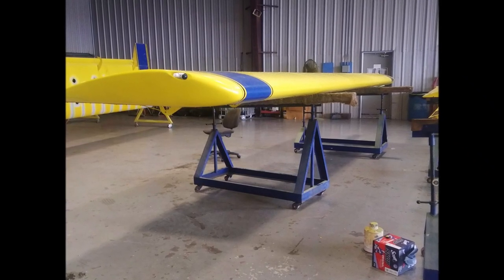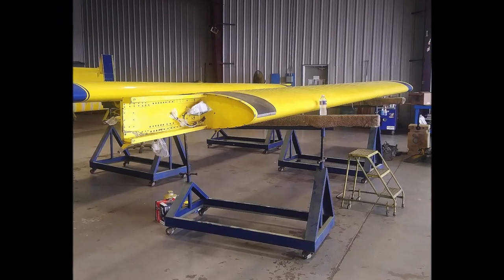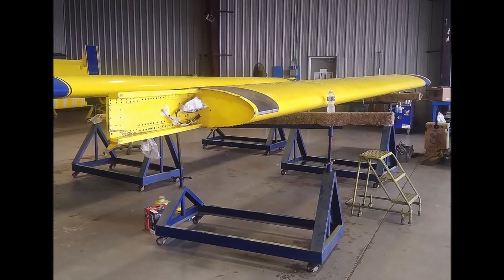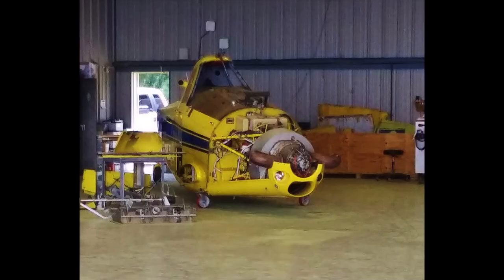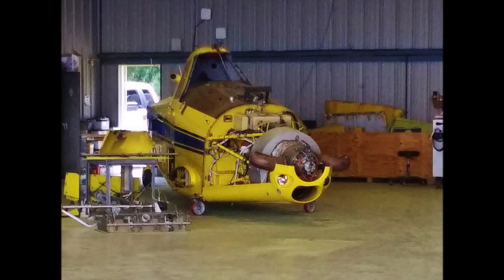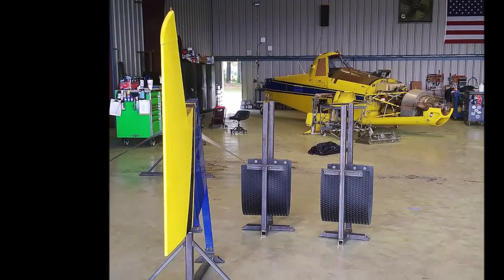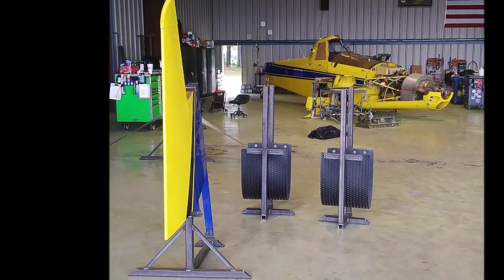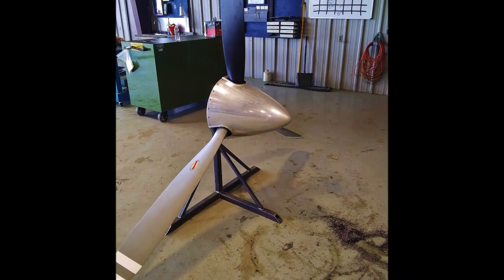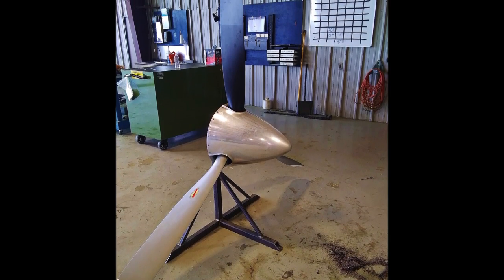This is the wing after it's been removed from the aircraft, sitting on one of the maintenance stands. This isn't how we sent it — this is just sitting in the shop. This is the left wing you're looking at now. The part closest to you is actually the spar, and that's the main weight-carrying structure for the wing. This is the fuselage — as you can see, we've taken the landing gear off and manufactured little casters to go underneath it so we could roll it around. You can see the vertical stabilizer on the left side on a stand that we built, and those other two stands are wing cradles. That's how we put it in the shipping container. And this is the propeller — we had to make a stand for it to sit on so it would ship in a vertical position, because it just takes up too much space laying horizontal.